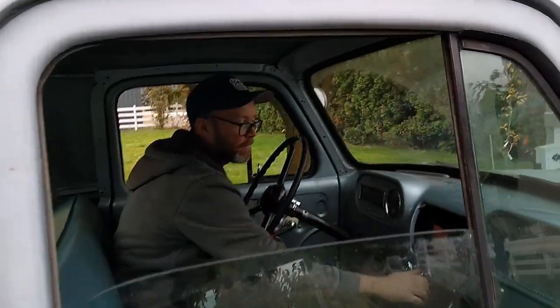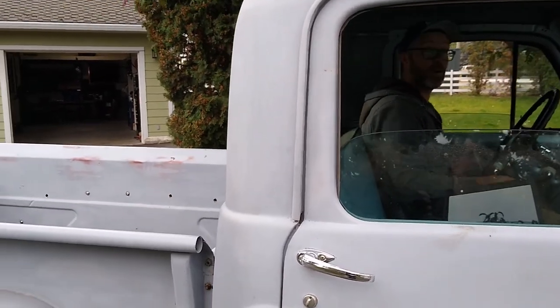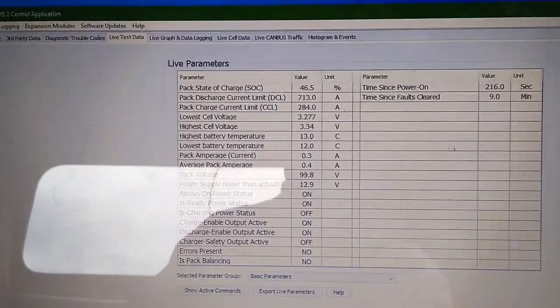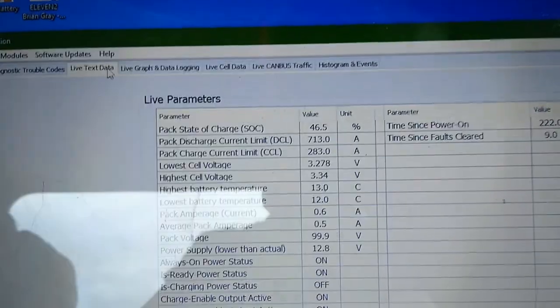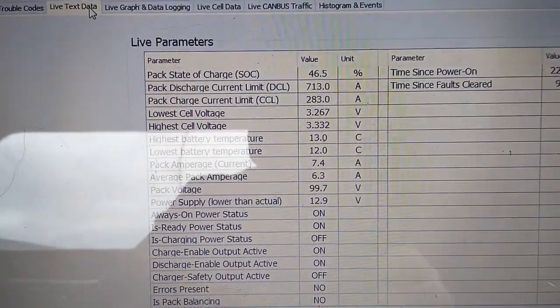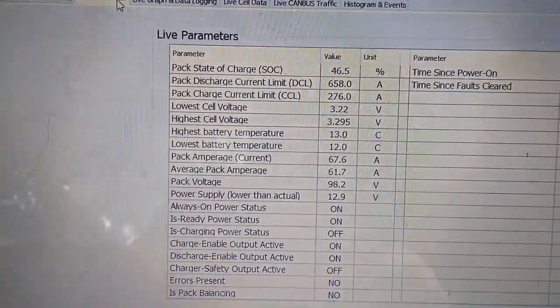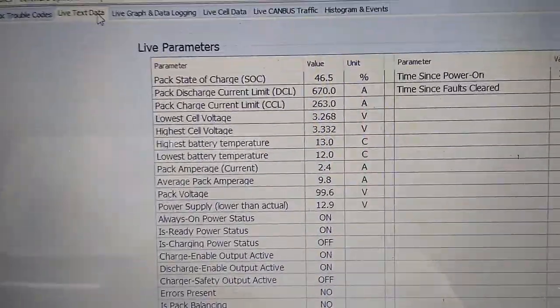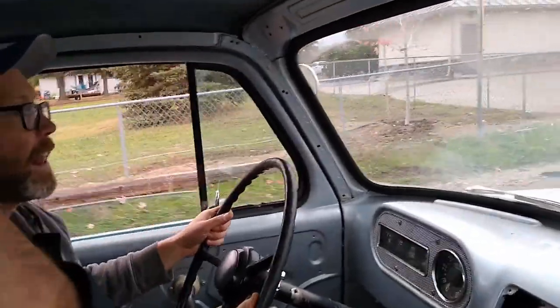I got a new relay for the brake, but I'm going to make sure we've got brakes before we go anywhere. I'm going to use the thumb throttle to see how many amps — I want to make sure the limit is showing 713 amps. She's taking off — 660, 650, 660. That was a good test. Things are working really good. I'm right on 30 cells now, but the BMS is happy — it's not shutting down.